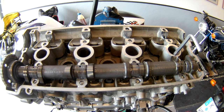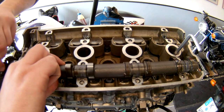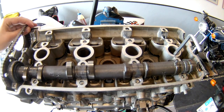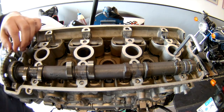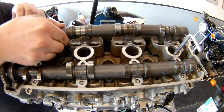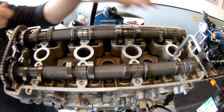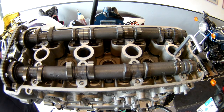It's easier to start with the exhaust side because the cam chain tensioner is located on the intake side, so the timing chain — cam chain — will be a lot harder to get onto the camshaft sprocket on the exhaust side. Don't forget to put extra moly paste onto all the surfaces where the camshaft is going to rub on the cylinder head. I'll show you what it looks like in the manual.